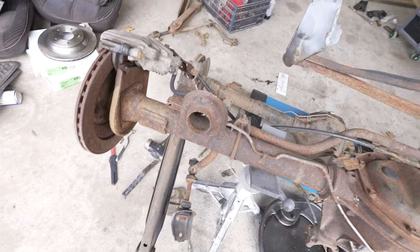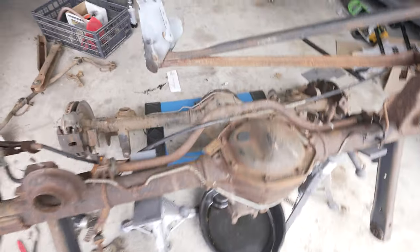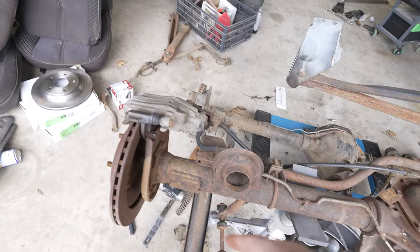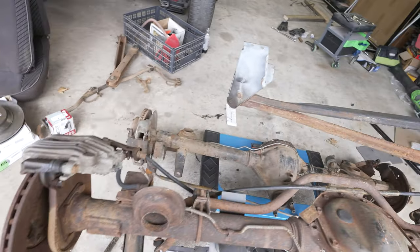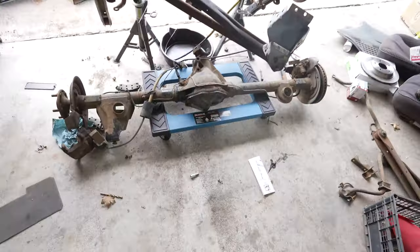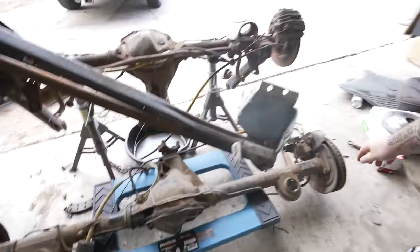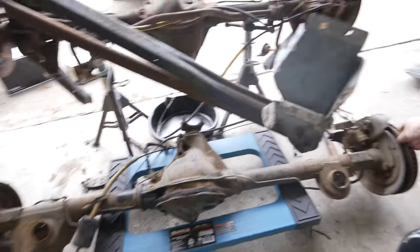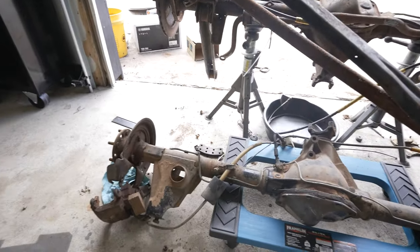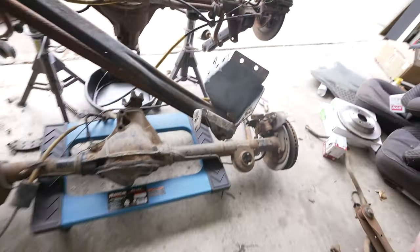What I'm probably going to do is put those backing plates on that rear end, because they're both nine bolt BorgWarner 277s — but that one doesn't have all the nasty corrosion this one has, while this one has the cool brakes. So I'll Frankenstein them together. Also, these are all POSI units. A way to test to see if your POSI is working — just spin this axle, and you should see that one spinning too. See that? All of it's spinning because the POSI is working.